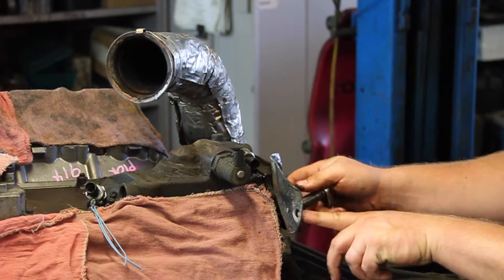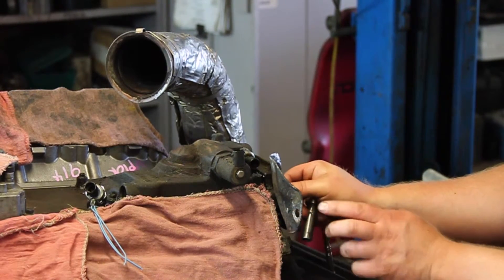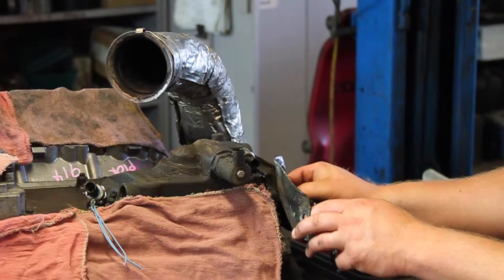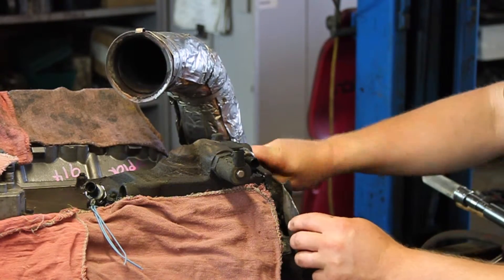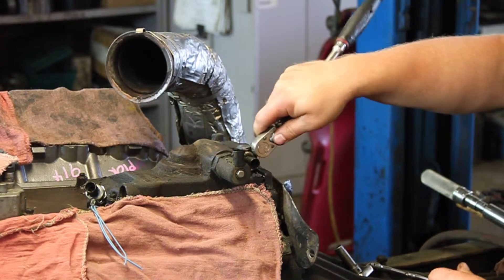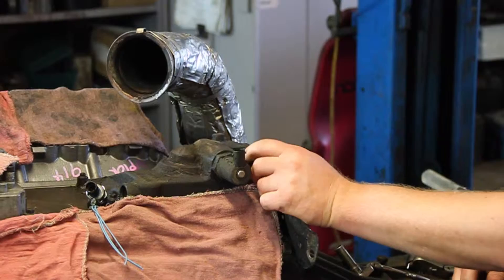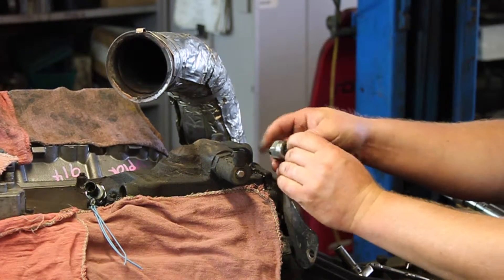I prefer to do it by removing this bolt here from the cylinder head. Then I'll notch the heat shield so I can start the bolt and slip it back into place. Remove a couple of these 10 millimeter head bolts off the back and you can get the heat shield down out of your way. Then I'm going to take a special crow's foot socket, reach in there and get this broken loose — quite often that's all you have to do. Break it loose, it'll come out by hand; you can sneak your hand in there and get the old sensor out.